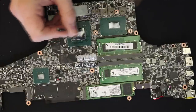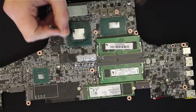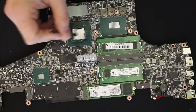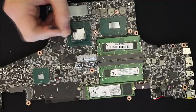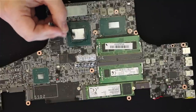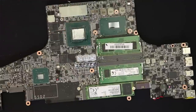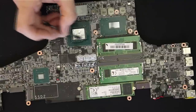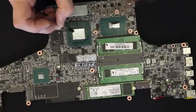With the liquid metal, you're going to want to go slow and spread it around until it is a mirror finish. You don't want it too thin, but you don't want it pooling up either. A lot of times liquid metal does not like to apply, so you have to work with it a lot. After I'm done applying the liquid metal to the actual dies, I put it on the cooling side as well — on the heat sinks on the actual blowers on the other side. My camera ended up dying and I didn't get video of the reassemble, but it did go together pretty well.